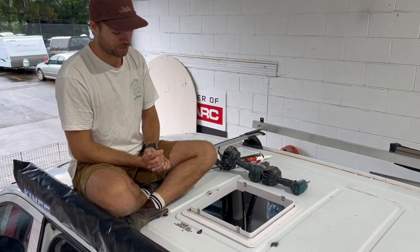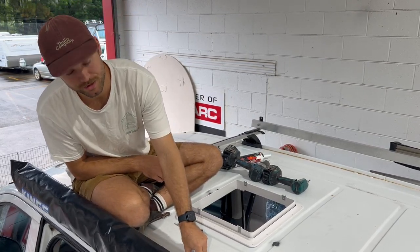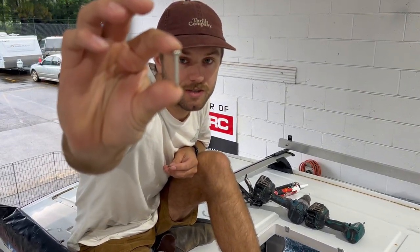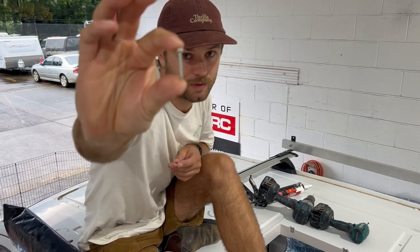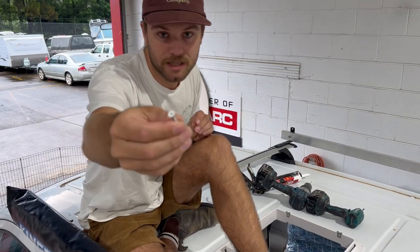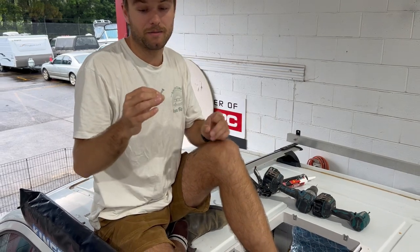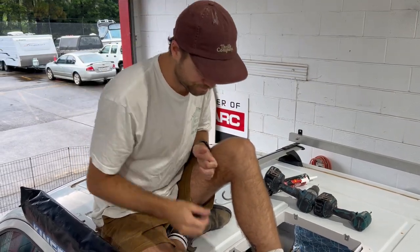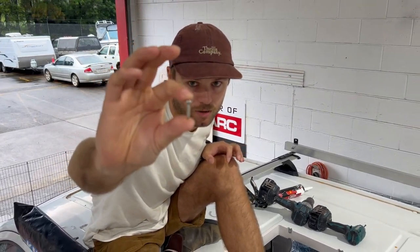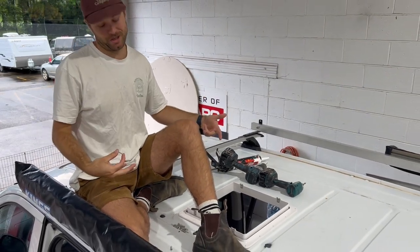All right. Before we screw it on, you'll notice in your bag of goodies that there are three different types of screws. You have the biggest, longer, kind of skinnier screws. These guys are what we're going to use to actually fit the flange to the roof. You'll have four of these white tip screws. This is what we use to put the garnish underneath, so the screws kind of sink in with the trim. And then we have four of these fatter gauge and a lot smaller screws. This is what we use to actually put the Maxxfan into the flange.